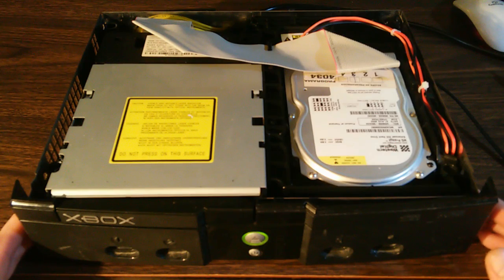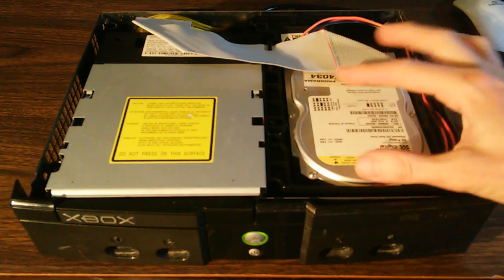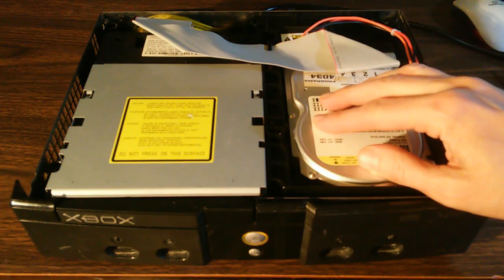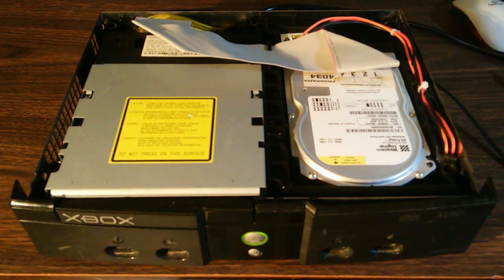Now this locking of the disk drive makes troubleshooting and repairing difficult because you can't simply remove this disk drive and plug it into another computer and work on it because it's locked. You can't read it. Now one way to obtain that key number is reading it directly off the EEPROM chip itself, and that is possible to do.